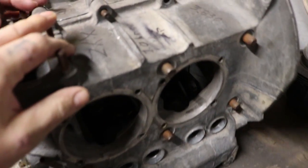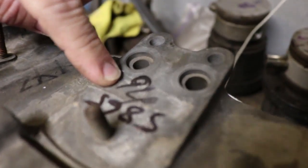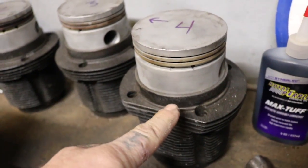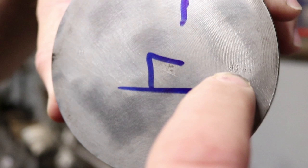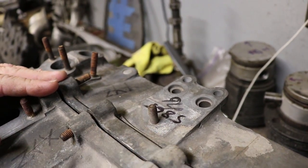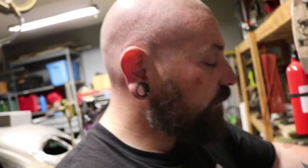The plans for this case are already done. We have numbers on here — it's cut for 94s. 94 mil is the inside diameter, going off the pistons. Technically the pistons aren't even 94 — it says here they're 93.93. We trust this number because we got it from someone who's well-known in the Volkswagen community, and we'll probably meet up with him later.